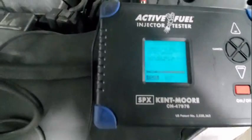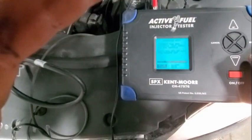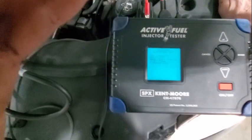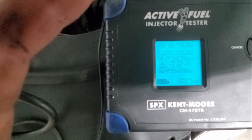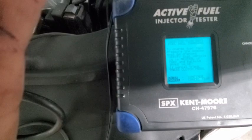Charging. Start test — turn the key on with the engine off. Key is on, engine's off. Start test, hit enter. Injectors — electrical measurement. Injector flow test — fuel rail charging. To charge fuel rail pressure, the engine must be cranked. Verify vehicle is in neutral or park and parking brake is set. Let's go ahead and enter — it should automatically do that.